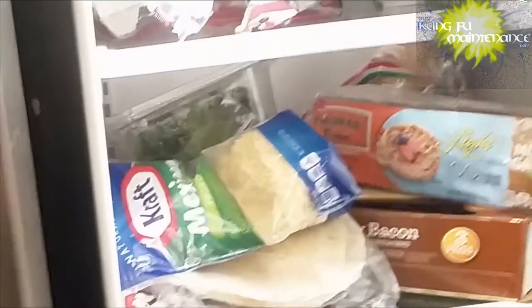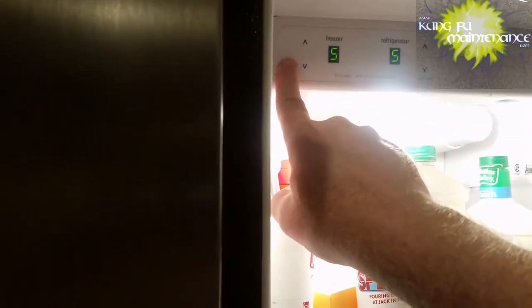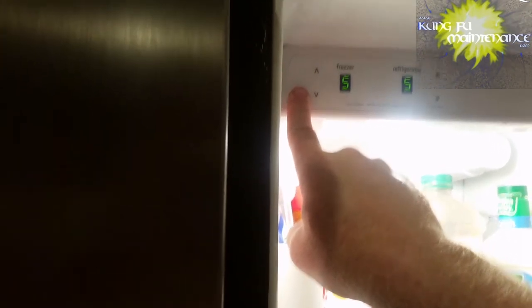Thought is maybe now we're in the defrost cycle, which is probably a good thing. Looking in here, I see a lot of ice. Okay, so what's happening is it's frozen, and the fan motor is laying on the ice, so it's not good. So we definitely want to defrost it for a little while, whether by turning it off or bringing it into the defrost cycle.